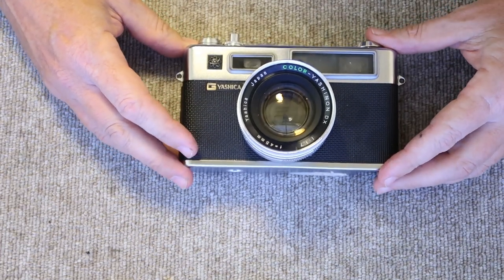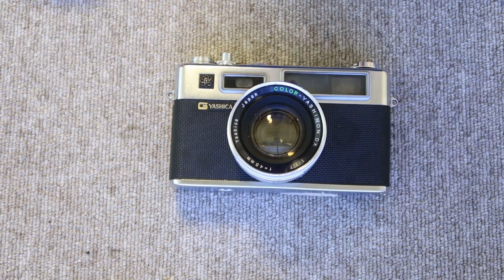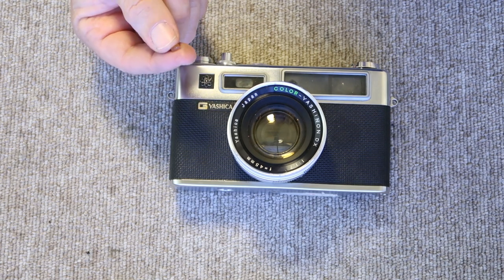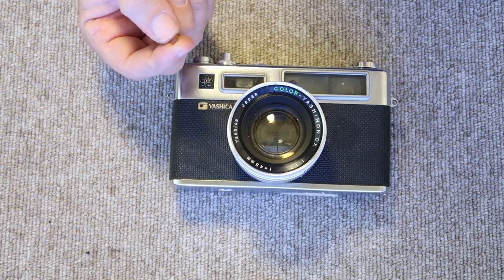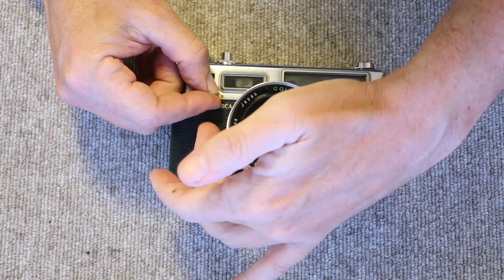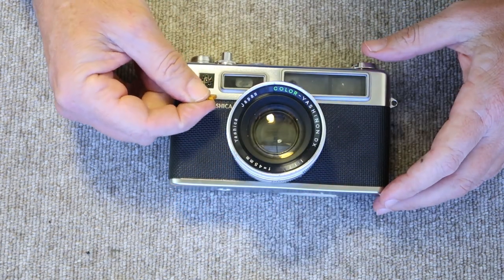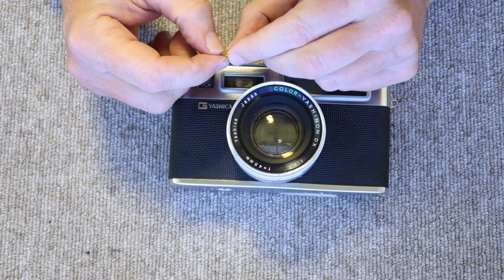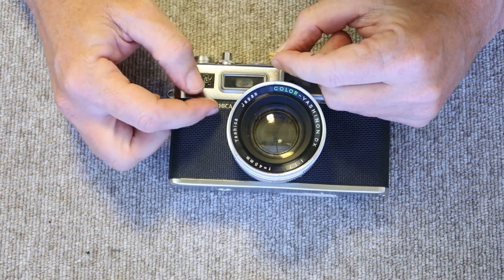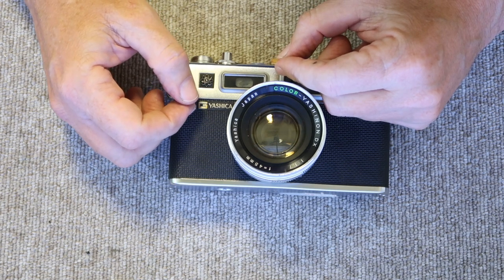The POD, or pad of death, sounds like a really big deal — like a dangerous or some kind of crazy thing — but all it is, it's this simple urethane square. This little thing I have here, this is the POD, and what it is, it's just a urethane spacer which fits between the shutter button assembly and the plunger assembly on the bottom, which comes in contact with the electrical contacts. If this urethane spacer becomes rotted or deteriorated or falls out, the gap closes between these two assemblies, and they don't make proper contact with the switch on the inside, and therefore the shutter doesn't operate properly.